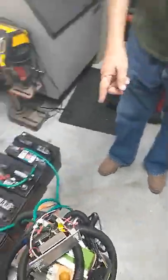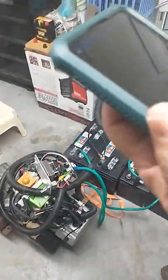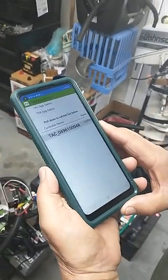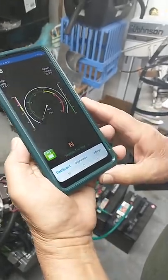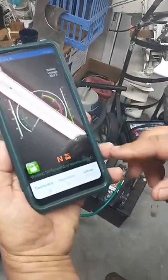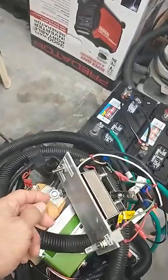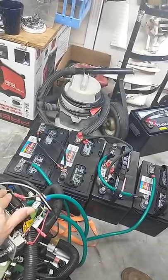There's the app — it shows tack and faults. Now waiting for key. When we turn the key switch on, it says waiting for forward or reverse. We turn that forward switch on, and now it says waiting for foot switch, which is the accelerator.